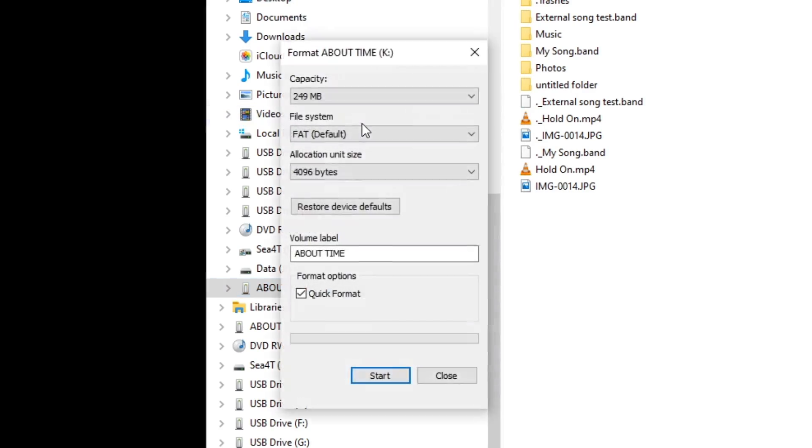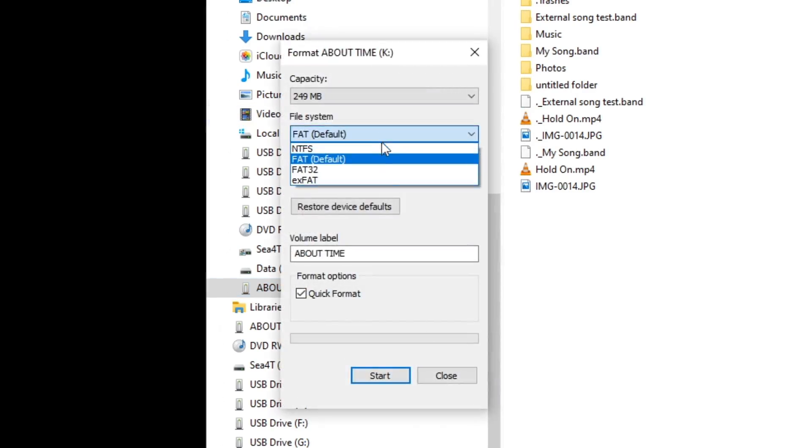My third tip is around drive format. If your drive is formatted using NTFS, which is a standard Windows format, it won't be readable by your iPhone or iPad. What you'll need to do is plug it into your Windows PC, go into the drive format, and if it's NTFS, copy the contents onto another drive, then reformat it as exFAT format and it will work. If it is a standard Mac or Apple format drive, it should work out of the box. But if you're having trouble and your drive is not showing up, that's another reason it may be the case.